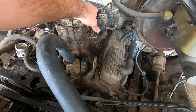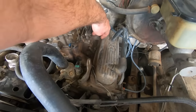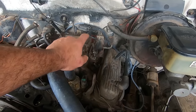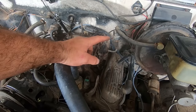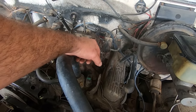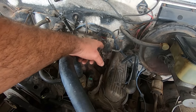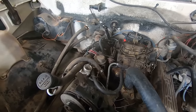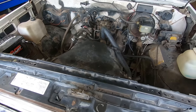play. It should go back quite a bit further, but we can address that if it works. That's how they had their spring hooked up, so we're just leaving it. Nice part about this Turbo 400 is their electronic kickdown, your worthless information for the day, and the kickdown is on the throttle pedal, so they don't have a TV cable like a 700R4 or a kickdown like a Turbo 350 or 200 or whatever up here, so didn't have to deal with that. But yeah, got our vacuum advance hooked up, so let's see if it runs any better.